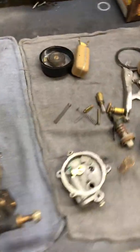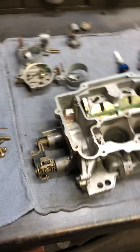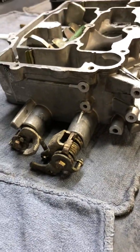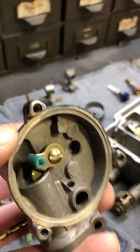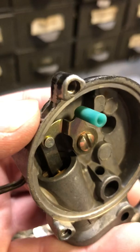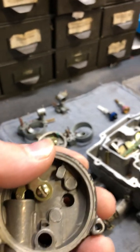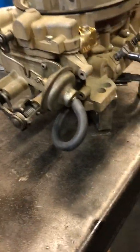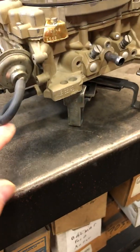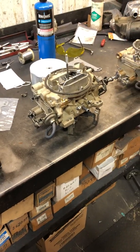The choke — this is what a choke housing looks like. This choke housing is what that choke kit is. On the Edelbrock, or this one off the Mercury, you can see this port here is vacuum. The choke pull-off is integral to the choke housing — there's a piston, and vacuum moves through this port. When you start the engine, that's the choke pull-off action — it pulls the choke butterfly down a little bit and opens up the valve so it doesn't run too rich. If you want to put that choke on a Chrysler carburetor, you would have to remove the small nipple where the choke pull-off hose connects. It's doable, but it'd be a lot of work.